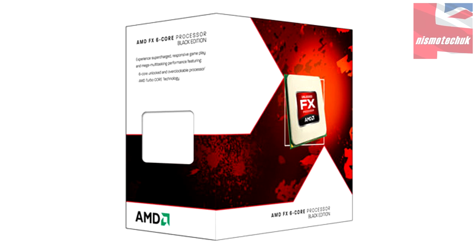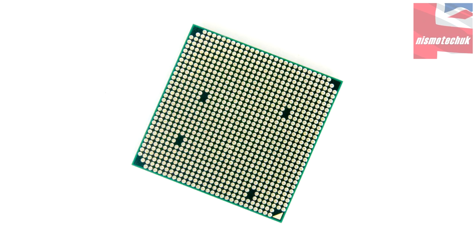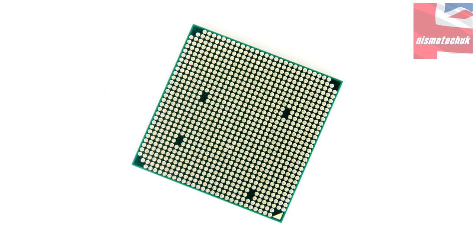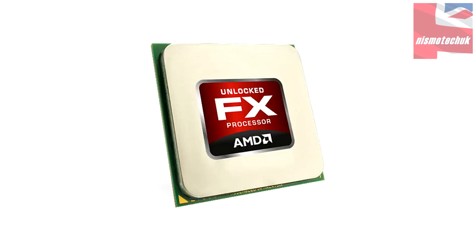Just to cover a couple of the features: it features new instruction capabilities, AMD balanced smart cache, AMD wide floating point accelerator, hyper transport technology, and the new Piledriver micro architecture, which is the second generation of the AMD Bulldozer. The internal core structure has basically been modified for higher frequencies without changing the manufacturing process. So they essentially developed the existing Bulldozer processor and made it more efficient and running a lot better.